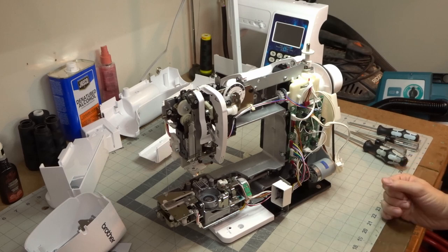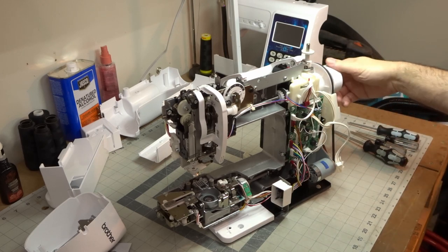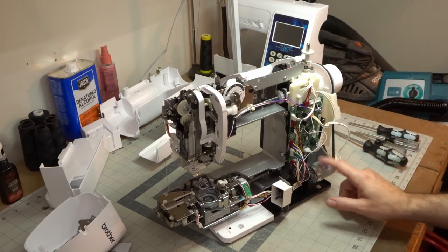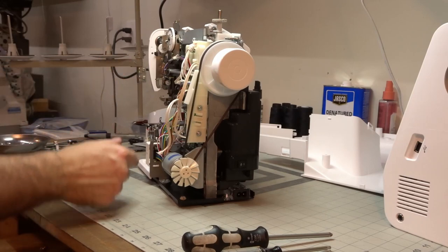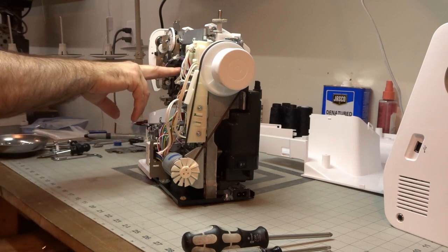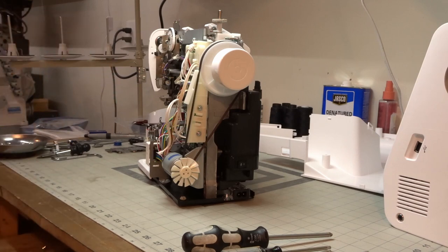Now I'm going to go down through my list of things I want to talk about during these reviews. The type of machine: we know this is a rotating hook machine. It's got infinitely variable speed control because this is electronically controlled. The speed you control with the switch on top — we found out earlier that in reverse it's the same as what you had set for forward, so the forward and reverse speeds are the same depending on that setting. I like that.